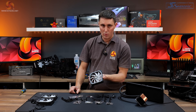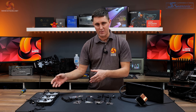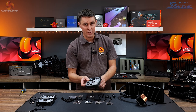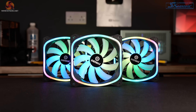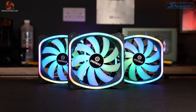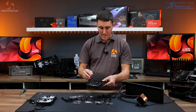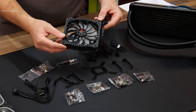These are the Enermax Square RGB fans — a very strange name, seemingly referring to their square shape. With the fans you get PWM control, a speed range of 500 to 2000 RPM, and two zones of RGB lighting: a ring around the outside of the fan frame and the opaque blade. The fan has quite a small hub so the blades are able to be larger. On the back there are 13 vanes which are supposed to improve air pressure, though with so many, they may create extra noise — every time a fan blade passes over them it will create some turbulence.